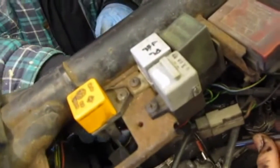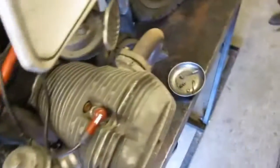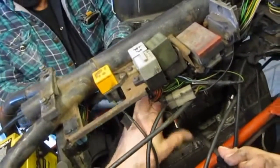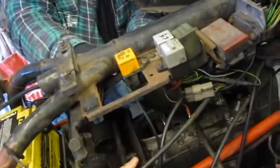The bolt on this side that mounts the starter is hidden, so I'm just going to withdraw that using a magnet. Now we can just jiggle the starter up, lift it out carefully, and it comes out to the left hand side. So there's the starter motor off.